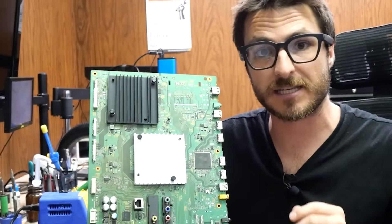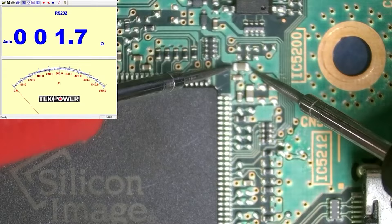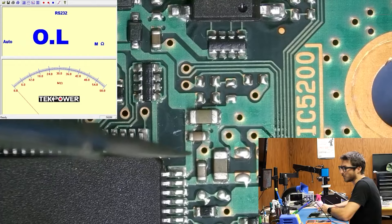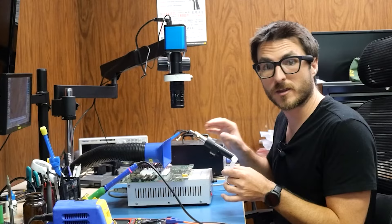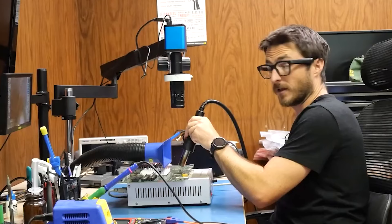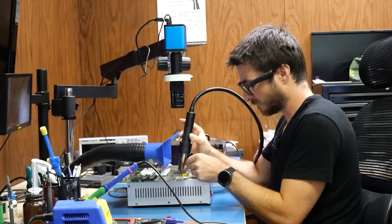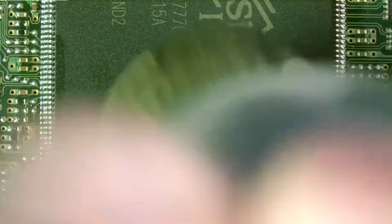Non-functioning HDMI ports can commonly be caused by the HDMI processor, which often shorts out. Before live testing the board, we check for shorts on the HDMI processor. Focusing on the top right corner, we measure a large capacitor and get about 1.7 ohms — that's a short. On a known good board, the same capacitor reads 24.31 kilo ohms. We'll replace the IC chip and recheck the capacitor for shorts. The board is preheated with bottom heat at 300°F, then flux is added and the heat gun is set to 375°C at 100% air, bumping to 400°C when needed, until the chip gives way.